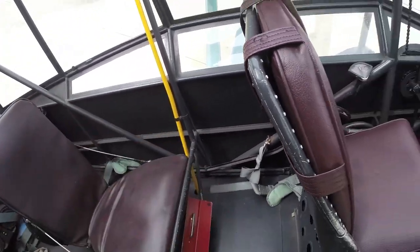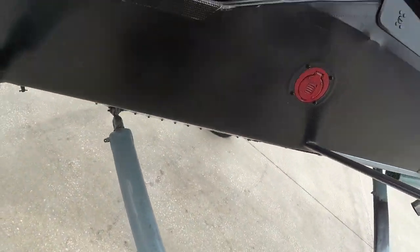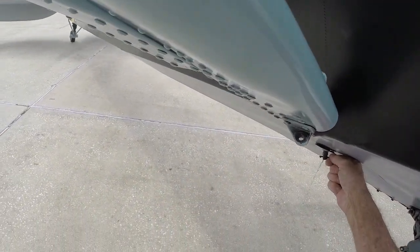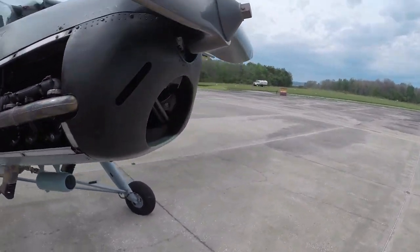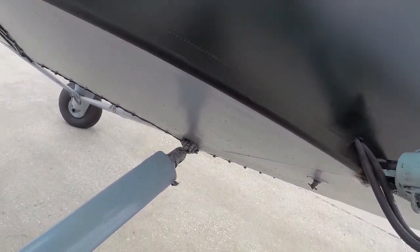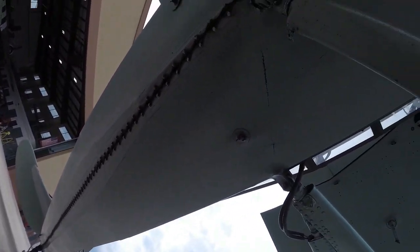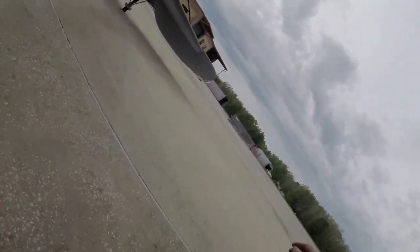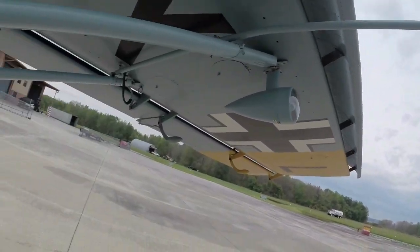This is a place for an external battery to start. We'll go ahead and drain a little bit of fuel out of here — haven't flown it in a while. You can tell by the dark blue dot there that I've not drained any fuel out of there in a while. The airplane just came out of annual, so I need to do a test flight. It smells like fuel, not water. You can also see the lacing — another way they would inspect the airplane — which allows you to see into the fabric belly. Here's the pitot lines going out to the pitot tube, the static and pressure lines going out there.